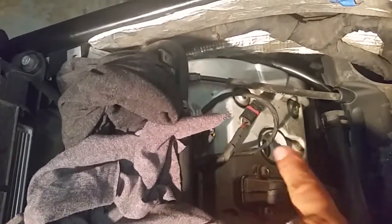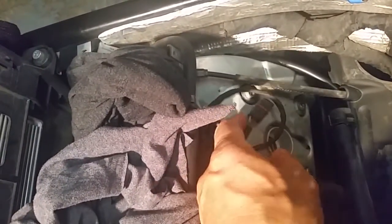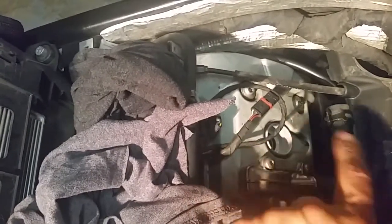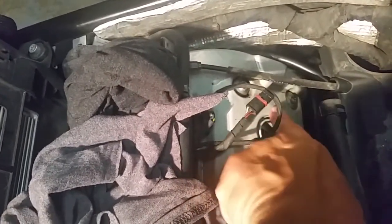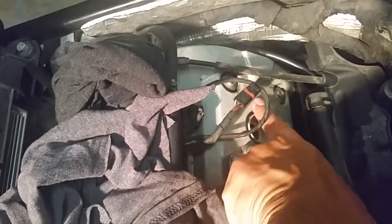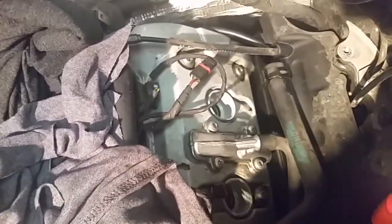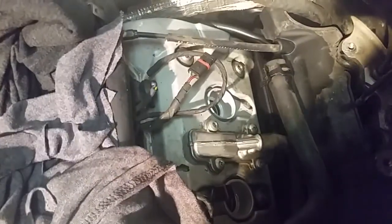And to get these guys off, remove the plug right here, and then go ahead and lift up the gasket, it's kind of a seal like a skirt, and spray some WD-40, and you can just twist the unit around slowly. I took my time on this, so I sprayed a little bit today, yesterday, and so on. And then I wound up just pulling the ignition coil out completely. I'll show you those in a second.